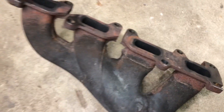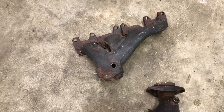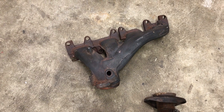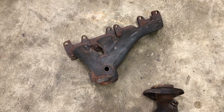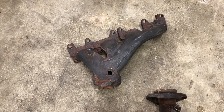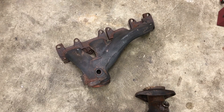The cracks happen between each one of the runners. The first thing I did when this happened was go out and look for an aftermarket option so I wouldn't have to keep buying these manifolds — I think they're over $100 each, and it adds up quick. I ended up not finding anything aftermarket, so I had to go with the stock replacement at AutoZone. It just kept happening, so that was another reason for doing the turbo setup, just to get that issue resolved.